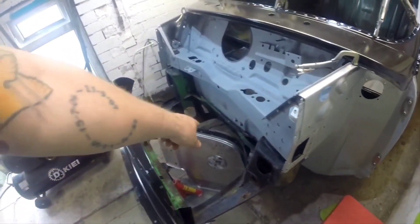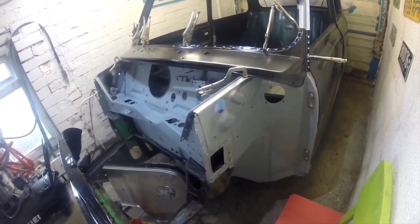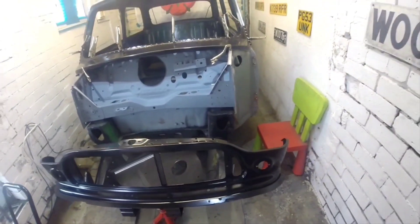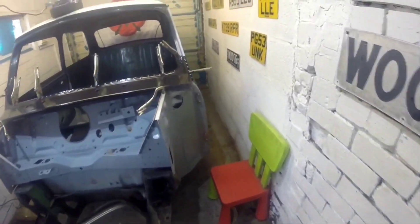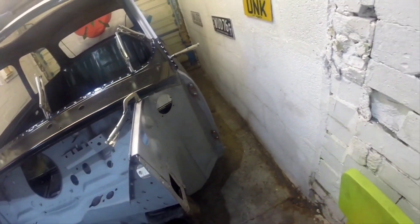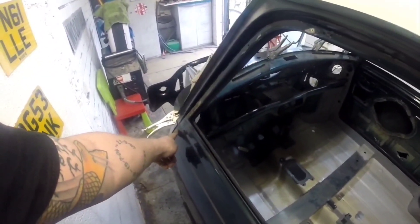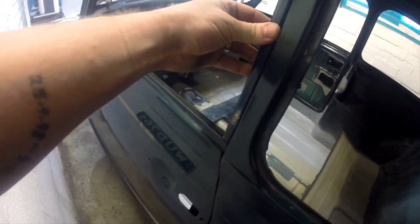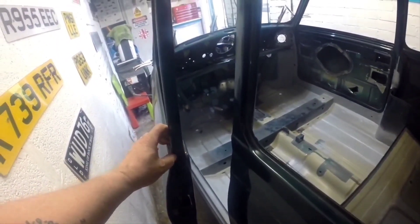It's not a problem — I've got plenty of cut-off metal. Once I've got that piece in I can start putting those on and shaping them. Hopefully we can start putting the bonnet on to make sure that the scuttle panel's in the right place. I've got the door on now. So the door is on. I've got one shim there, no shims in the bottom. This door is totally different to the other side, and it sort of hits there.